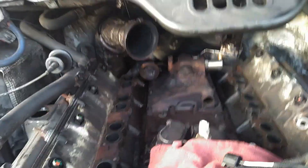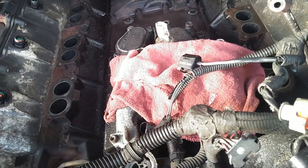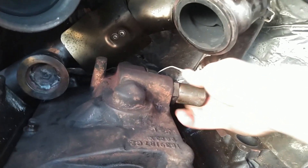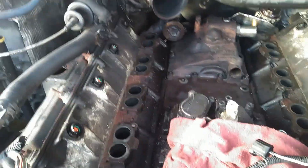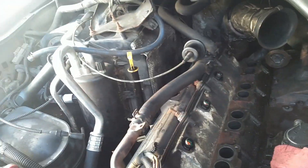I got the pump cover on and the IPR valve in there. If you've never done this before - once you tighten your IPR valve, if you don't have the electrical part lined up where you want it, you can turn just the solenoid - it turns on there, it's fine. You can twist it around to find where you want that to point.